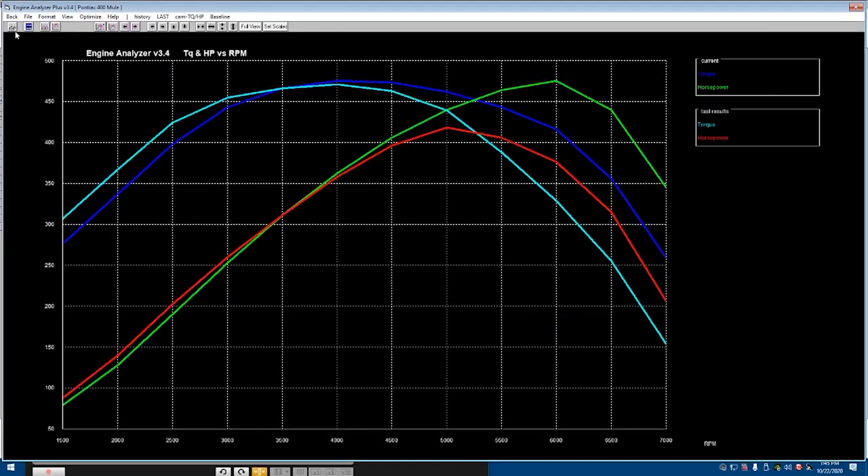Now, yes, this is a big gain, but I want to make the point here that this car is going to feel a little more lethargic down low. What that is caused by is the increasing of the port CCs actually decreased the port velocity — so that's what you're seeing here, the loss of torque. But with big gains up top because it can move more air.